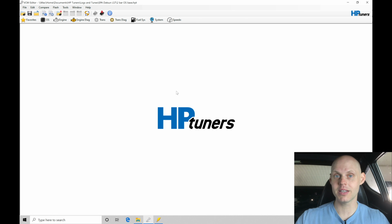Now, I went into the VCM scanner and I've created some custom channels here in order to start to take a look at some of our idle control parameters. I have noticed on this particular PCM that I have more channels for the idle control compared to when I did the initial Gen 4 training course last year, or maybe 18 months ago or so. I've found that I can actually see what the proportional integral terms that are being applied into the closed loop idle control feedback are doing.